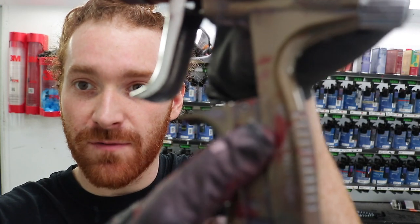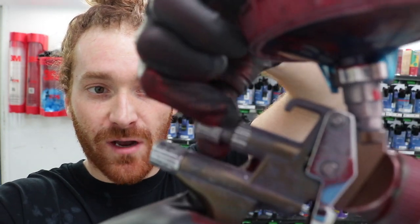which kind of makes it spray like an Iwata. Has a digital gauge for my air pressure. I spray it about 26, 27 PSI. The fluid, I leave it all the way out, even for clear coat. It's a 1.3 tip, so it's not real big. It's pretty common. Some people use the 1.4, but 1.3 tip, everything's inside. It's clean. I just cleaned it before I did this job here.